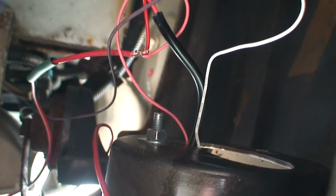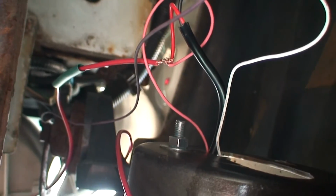Show you what I'm doing so far as wiring. Some red 14 gauge primary wire connects to the wiring on the light. This is part of the original wiring for this light, for the original. It's cut, broken. So I'm running a jumper across the bumper to the other light over there. It's a coil of wire there you can't really see. That side's going to provide power to this light here. In theory, I got some shrink tubing on here. So I just need to finish doing some connections, test it, and if it works, solder the connections so they stay, and then shrink tube it to keep it watertight. So, let me go do that real quick.